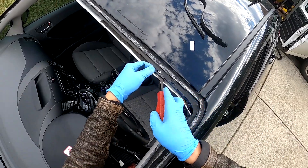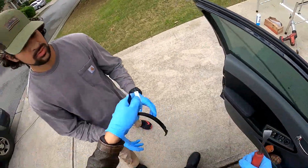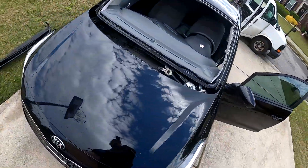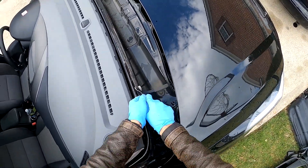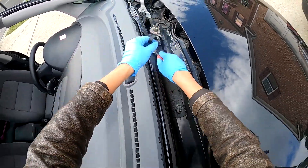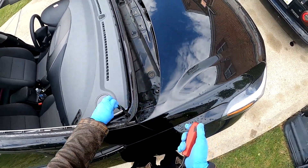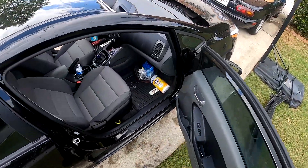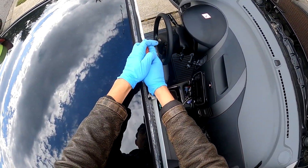Go ahead and pull those clips out too — when you cut the old windshield out there will be some clips left in there. Pull them out, as it reduces the chance of your customer complaining about a rumbling noise on top of the headliner. You do not want to have to cut out the glass to find out you could have avoided that by cleaning up after yourself. That's also why we started vacuuming — to make sure we left no dirt under the headliner.